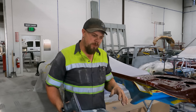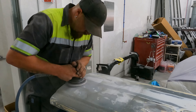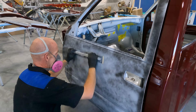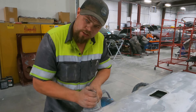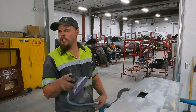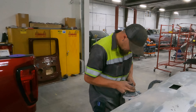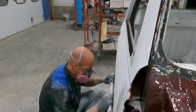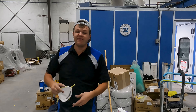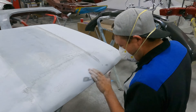Yesterday we did the paint stripper, got most of the paint off, but there's some paint and bondo that didn't come off, so I want to sand it off. Getting ready to block out the cab doors — any low spots we got to fix, and then we can get it sanded in the morning and painted. Me and Cody are getting to work on Aiden's front end. I'm blocking out the hood, Cody's working on the door — he's already got one door blocked out. Then we're going to block out the fenders, fix the imperfections, spot prime, then prep with 600 grit, seal, base, and clear.